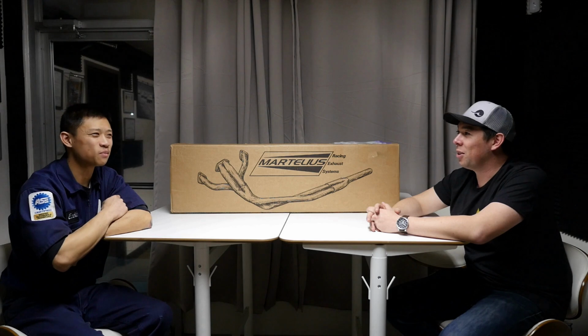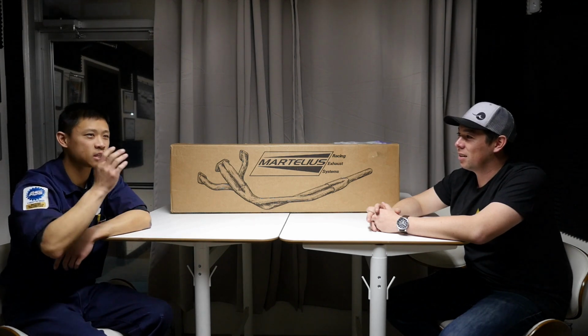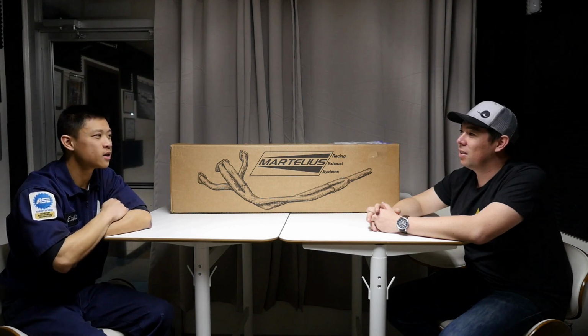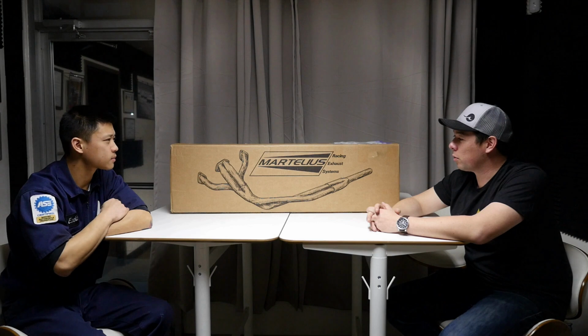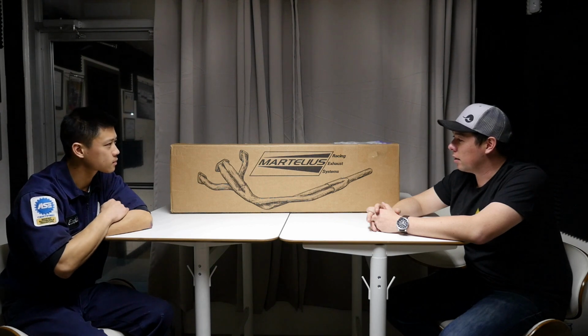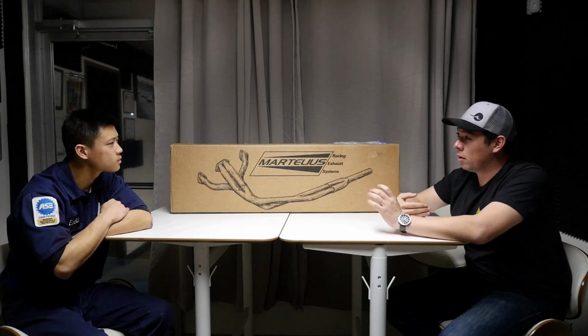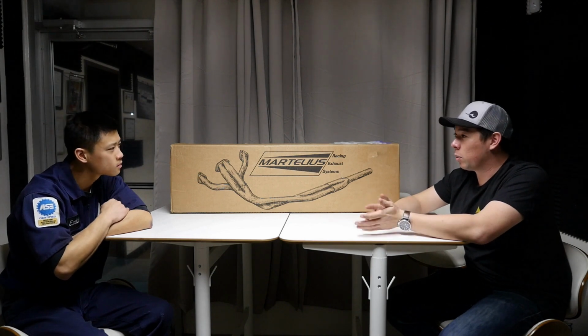Yeah, I did. Below mid-range, like when you're getting the car up to speed. On a Corolla, I'd say below mid-range is anything under 4. So below mid-range, I feel like I did lose some low-end grunt. That's really interesting for me because we studied the exhaust theory a long time ago. The idea was that if you have a smaller pipe, you're getting more velocity at the lower RPM to help scavenge and get more torque down low, but then it chokes up high. And so it seems like you were able to find that trade-off, right? Which I think is really interesting.